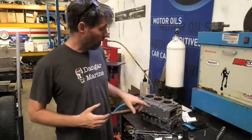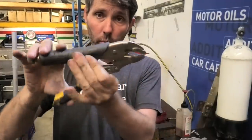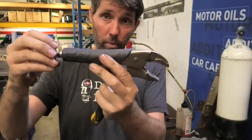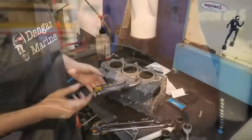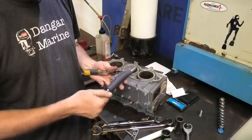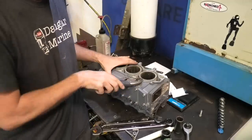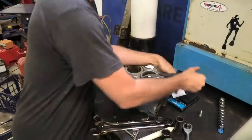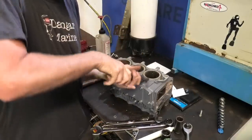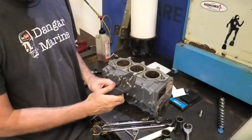Next easiest really is the one where the shank is still sticking up. I'm just going to grab some vice grips and have a go at winding it out. Vice grips have an adjuster so when you close them they'll get past a cam point and lock at a certain gap. I'm going to put the vice grips onto the bolt, wind it so I can't turn it anymore, then give a bit more of a turn for extra clamping force — and there we go. Pretty simple situation to be in as well.